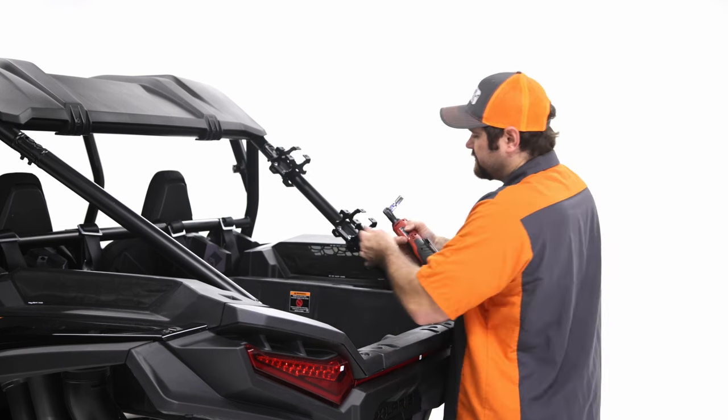Okay. So now the next step, we're gonna set the tailgate. Okay, what does set the tailgate mean? So this can move up and down because we haven't tightened these back brackets yet. And so if you have a spare tire, you're obviously gonna wanna really cheat this up a lot higher so that the weight of the tire will bring it down into the center of the receiving bracket. So you're gonna have to kinda figure out where that's gonna be. If you have a spare tire and you're gonna put it on here, you're gonna probably have to cheat it up rather high so that the weight will let it settle where it needs to be. So I like to kinda cheat it up a little bit higher, and